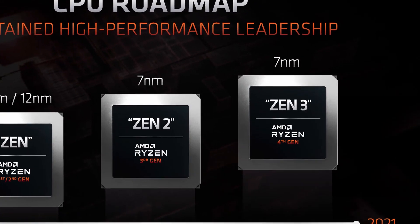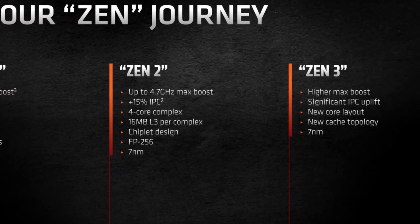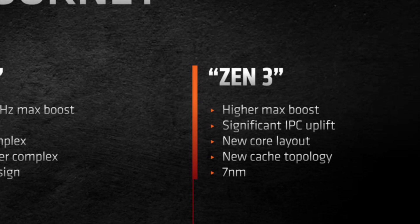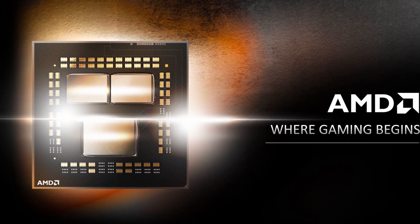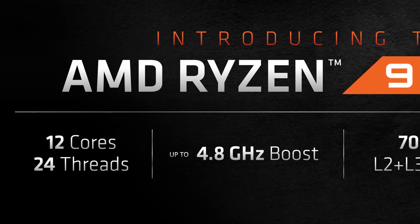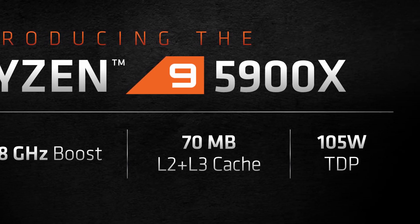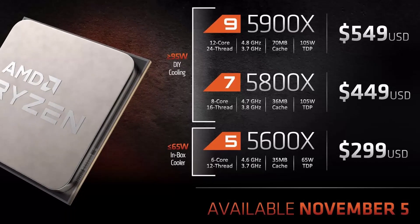The Vermeer microarchitecture is similar to previous generations and is also powered by a 7nm process node. The main benefits can be found in the significantly increased performance per clock and increased frequencies at a similar power level. The CPU is still chiplet-based and features the same IO die as previous generations. The Ryzen 9 5900X offers 12 cores and 24 threads with a listed base frequency of 3.7 GHz and a boost frequency up to 4.8 GHz, rated at 105 Watt TDP with an MSRP of $550.